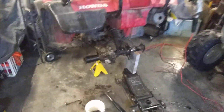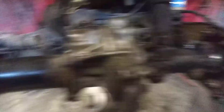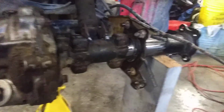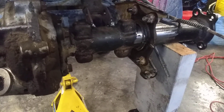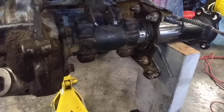If you're having issues getting the old differential out, just try to take off the whole thing. You don't have to take those nuts off the end — just take the whole thing off. You can even cut the end off with the axle still in there, and you might be able to just take the flange off the old diff without having to pull those nuts off.